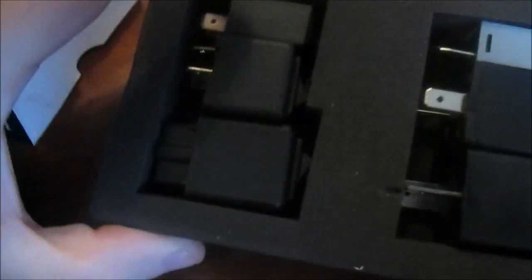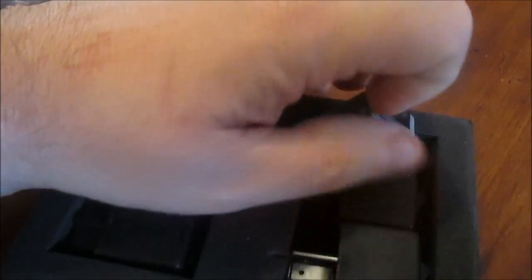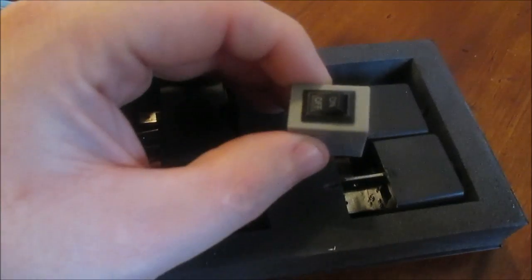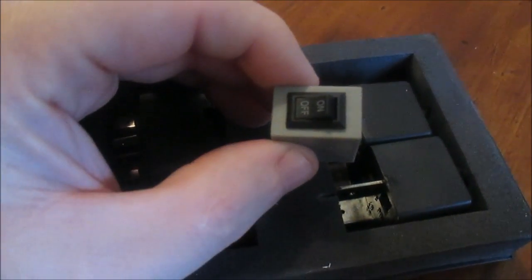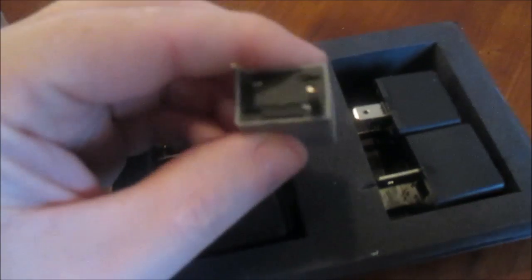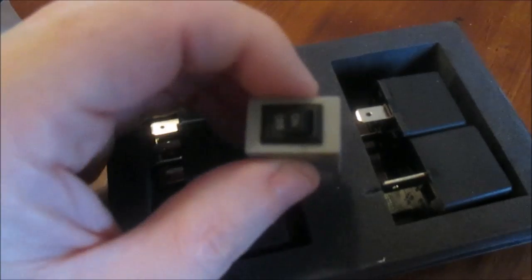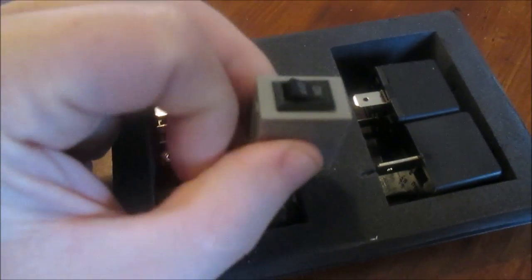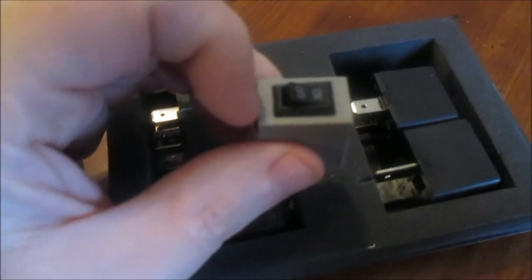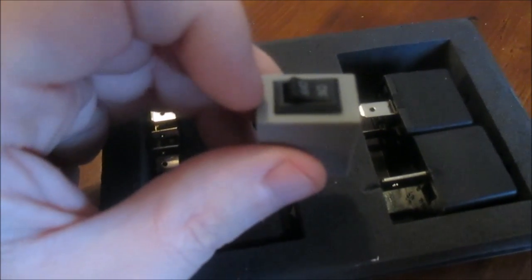It has about six relays in it. The way this works is it's designed to plug in place of your relay that's sitting there, and it only controls the load side — it takes the control side out of it. So you can manually plug this relay in the other relay's place and turn it on, which sends power across the load side of the contacts.